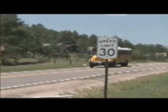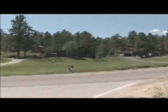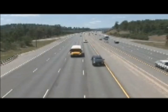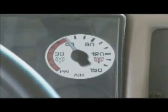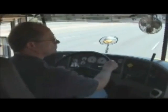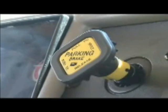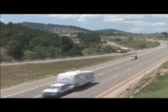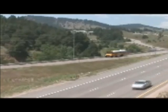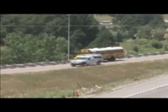Needless or repeated use of the brakes can deplete air faster than the compressor can replace it, creating a potentially dangerous condition. If air pressure drops below safe levels, both a red warning light and audible alarm are triggered. As pressure continues to drop, the dashboard pressure gauge drops into the red zone. If you find yourself in this situation, stay calm. Remember that emergency braking power is just a moment away. Your first thought should be to find a route that gets you safely off the road as soon as possible. Your emergency brakes will work, but they'll also begin to overheat, especially if you're headed downhill, and they'll begin to fade or lose effectiveness.